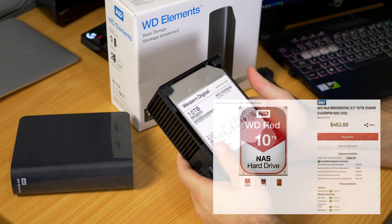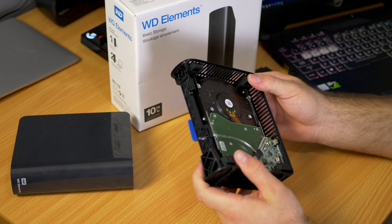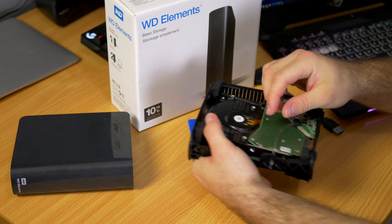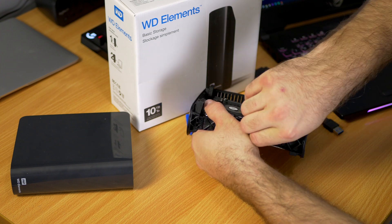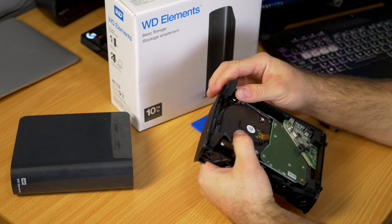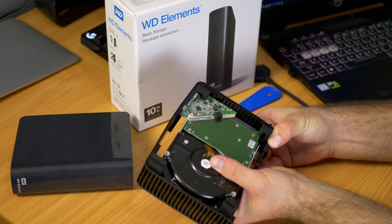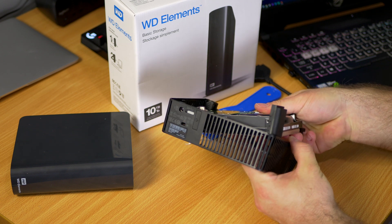It's actually a red label, and I'll link below what the actual hard drive is if you were to buy it officially through a proper store. The next thing we're going to do is remove it from this little cage. These little rubber grommets up here literally just pop out, so you can just push it through — no tool required. Make sure you pull out this little fiber optic cable beforehand so you don't break it, if you want to reuse the enclosure and want the light to work. You can't really damage this hard drive — after all, it's just a hard drive.